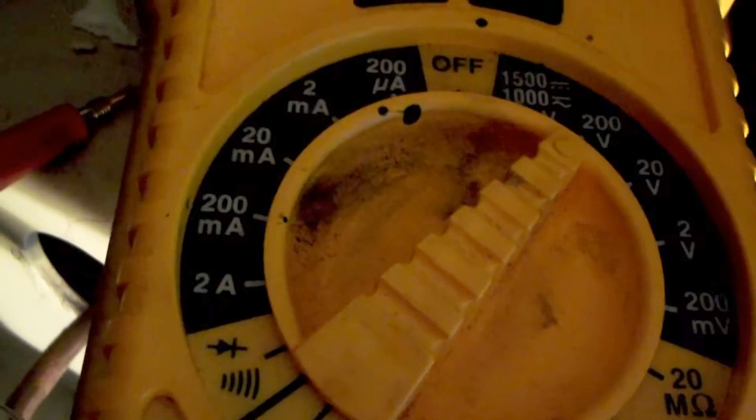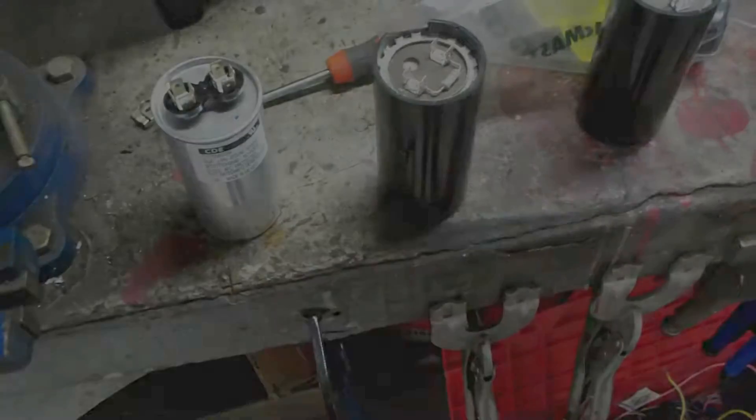We're moving upstairs to do some soldering - I'll do both sides. This is how the capacitors lay in there. I've already verified there is in fact no electrical current using my multimeter set to volts AC. All you do is pop it out of there and take off the two leads. Don't worry about marking them - it doesn't matter which side is which, it just provides power.